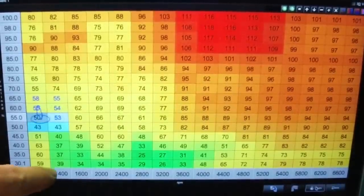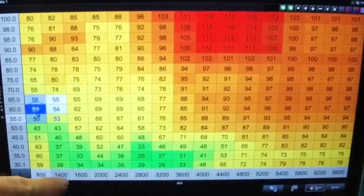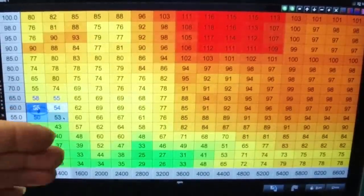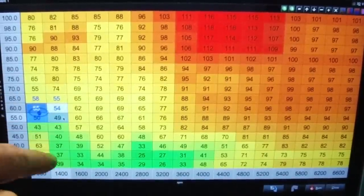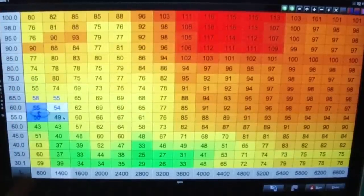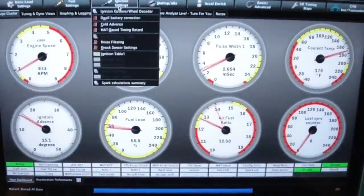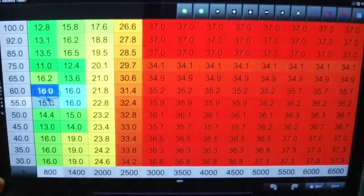Be careful — this is also RPM-rated. At 800 RPM, if it moves over here it's going to be in a higher RPM range. So we want to tell it: don't come over here, because if you do, we're going to take fuel away. Don't worry about the blocks for cruising because anytime you're cruising you'll be up above that anyway. Just do whatever you have to do in the idle area to make your car idle. That's decent right now.